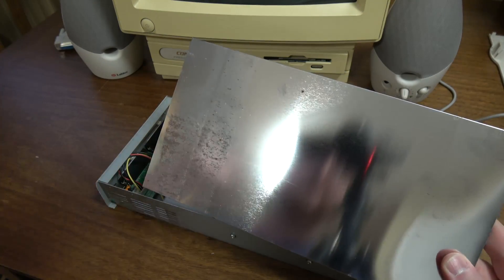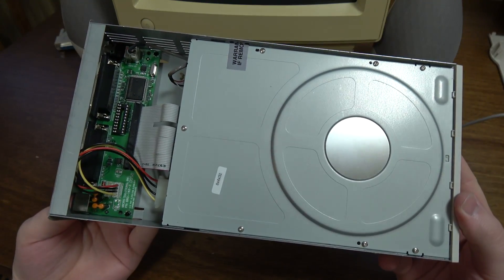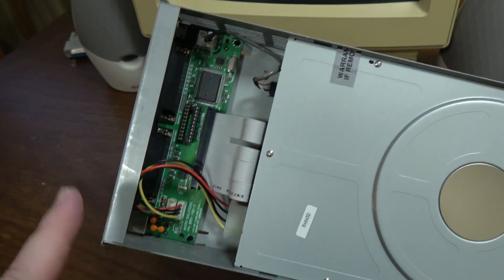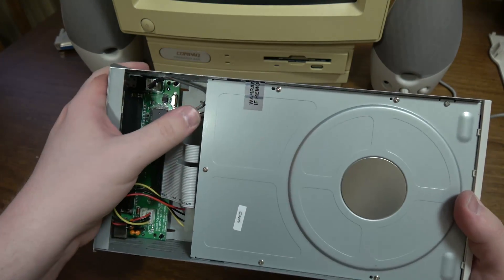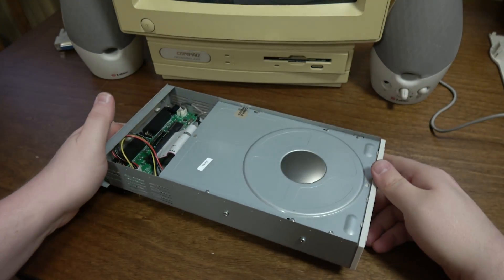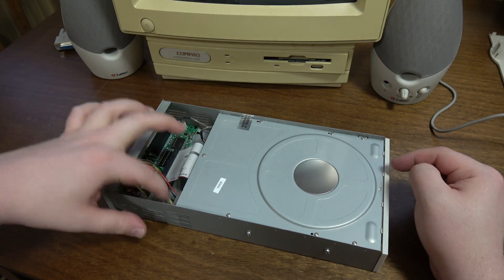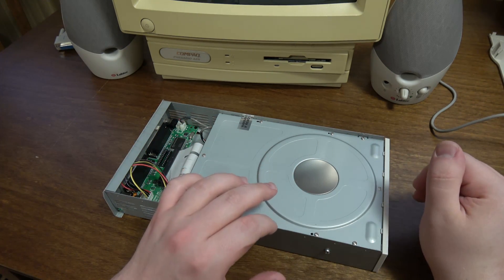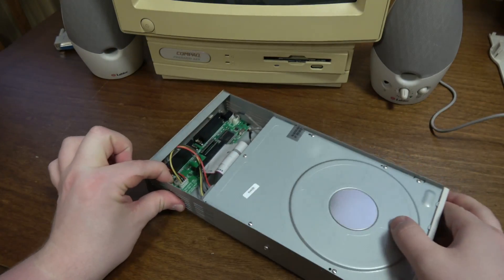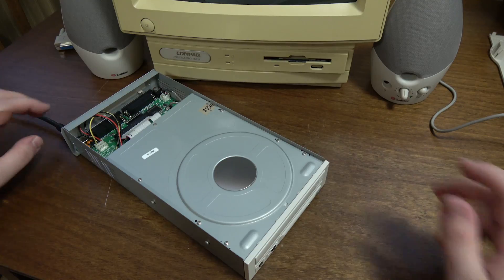Some oxidization, it looks like. That's about what I expected — it's just like a standard IDE, ATAPI-style CD-ROM. You've got the power supply connecting there. The power supply is external, of course, but this is where it connects. IDE connector. Got the 4-pin to 4-pin audio there for sound. Some little bug eggs of some kind right there. I think what I'm going to do is try switching this cable to this other little port here and see if that does anything. And that eliminates one thing.